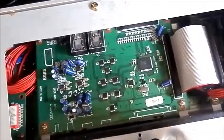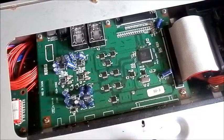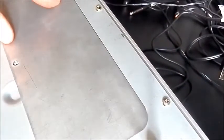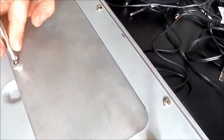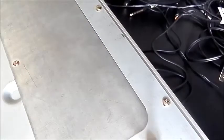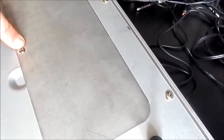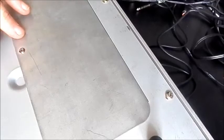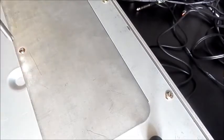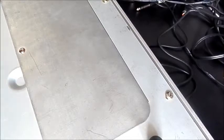I have remembered to plug in the ribbon connector, so electronically speaking that's all ready to go. Just got to put the cover back on, put those screws in the back and we'll give it a try. One little note: don't do up these screws too tightly when you replace these covers, because one day you're going to want to go back in there, or the next person who owns the keyboard might want to, and it's a real pain if they're trying to get them off and it accidentally burrs. There's no need to have them super tight.